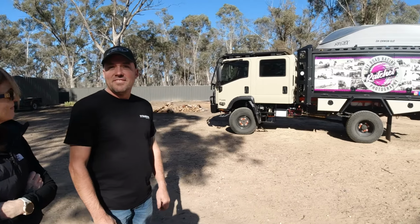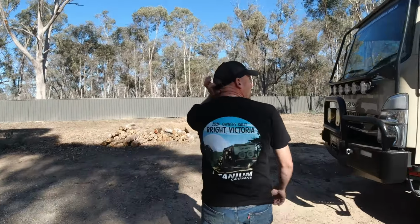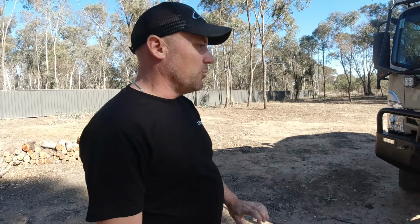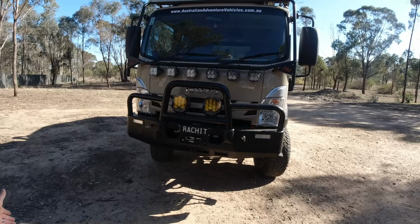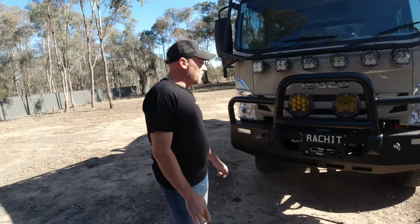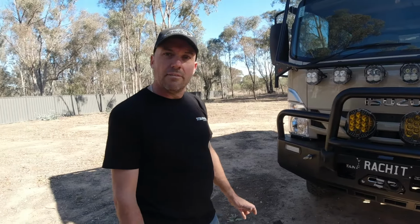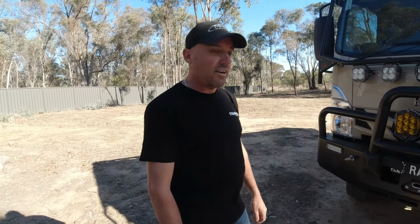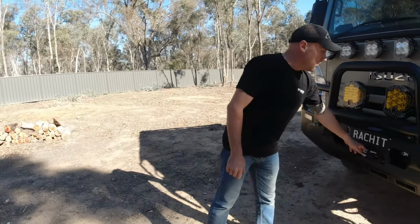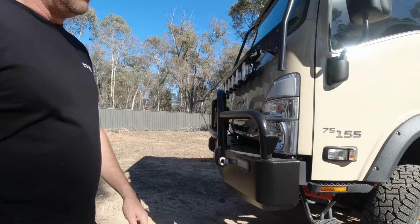So do you want to do a walk around the outside first and tell us what we've got? Start right. AAV is the company, Australian Adventure Vehicles, that built the original platform, as in they put the super singles on, and the bull bar, the winch, and that sort of thing. We've got a 20,000 pound winch at the front, and some decent lights. We've got the Baja Designs LP9s and LP4s, the type of lights that off-road racing in Mexico uses. They're quite bright, so they make it daylight driving at night. It's an alloy bull bar with a frame the winch sits in, and underneath they've got protectors that AAV have done for radiators and air conditioning cabinets.